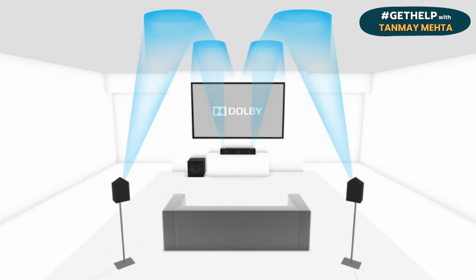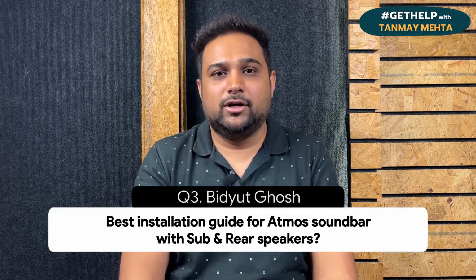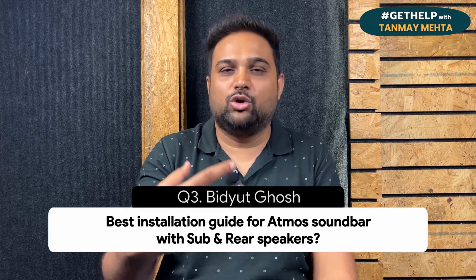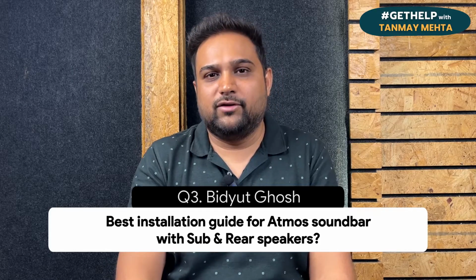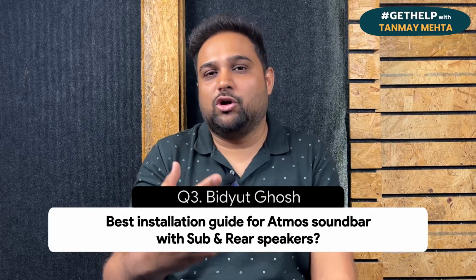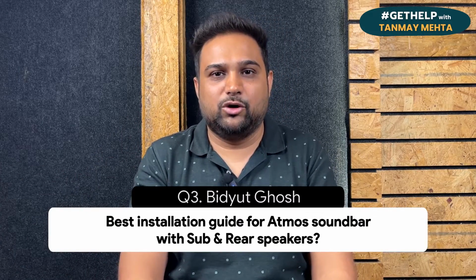So if you're going for an Atmos soundbar which has got a separate surrounds as well as a separate subwoofer, you have to understand that the front 3 speakers are going to be combined together in one small soundbar. So that means that 3 feet, 4 feet of that soundbar is going to give you the front left, center and the front right sound. Now when these 3 combine together, you're going to lose out on the vocals or on the dialogues. So definitely go for a soundbar which has got a provision to enhance the center channel so that the left right does not overpower the center and you are able to hear the dialogues very clearly, because that's a very common complaint with most of the soundbars, be it with separate surrounds or be it with a single soundbar wherein you get a 5.1 combination.